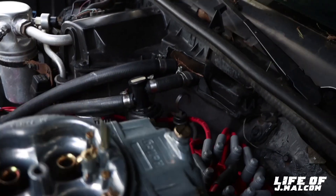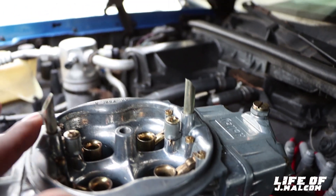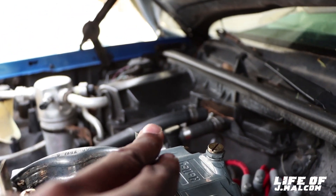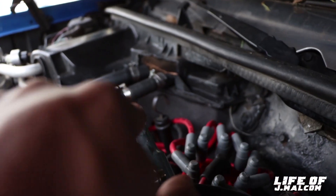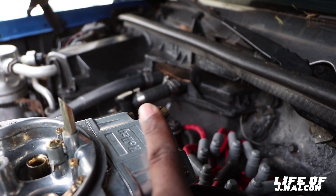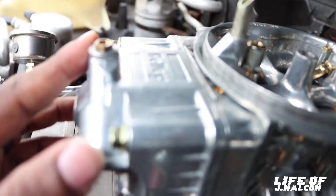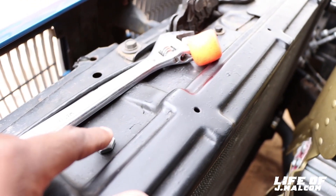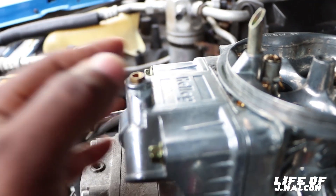This is your float level. That top screw — it's the same thing for the back, too. If you ever have gas shooting up through the roof out of this right here, you have gas shooting up like that, your needle and seat is dirty. So same thing: you take that big screw out with a flathead screwdriver — that's a lock screw. Then the nut right here — you see the gasket, you do not want to rip that. That's why I was careful when I was prying.